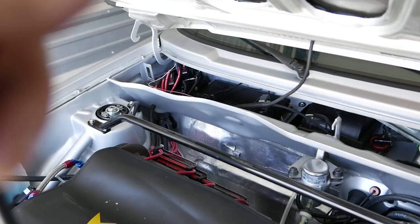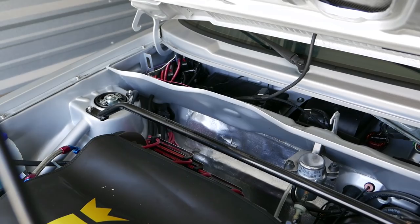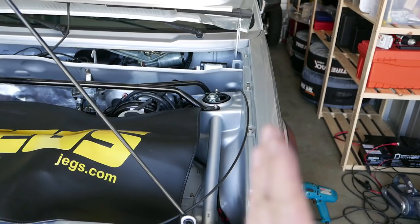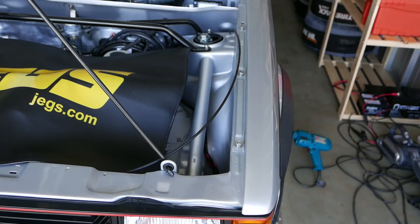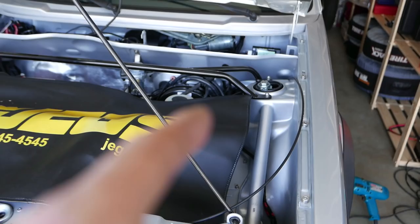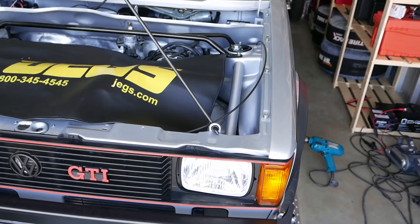It didn't seem to be a bad one, but there had been a fender that crunched. I checked all the squareness of the frame before I welded it up and it seemed to be bang on. I couldn't get down below — I couldn't get enough adjustability in the stock mechanism, so I've had to compensate up above, which is one of the reasons why this one has to work harder to get it into alignment.